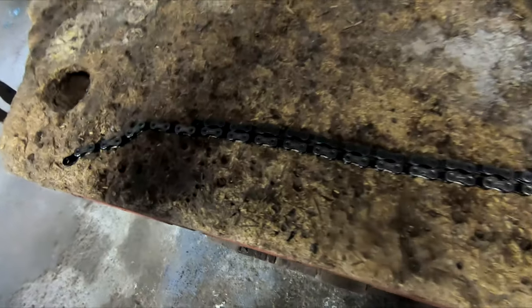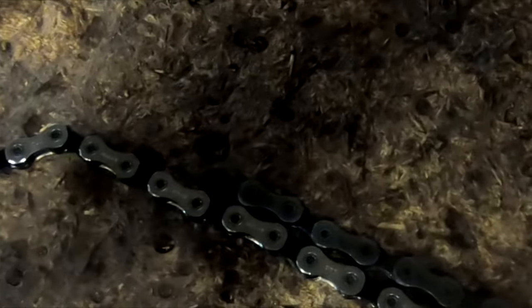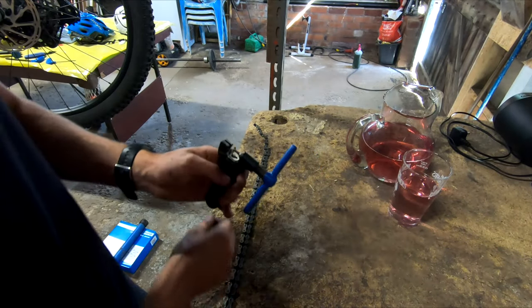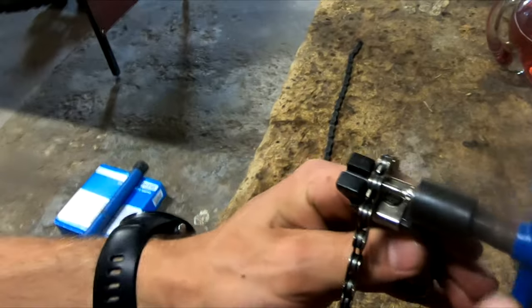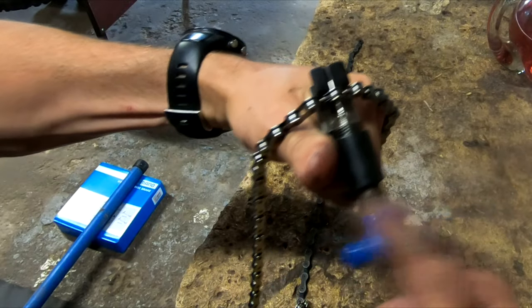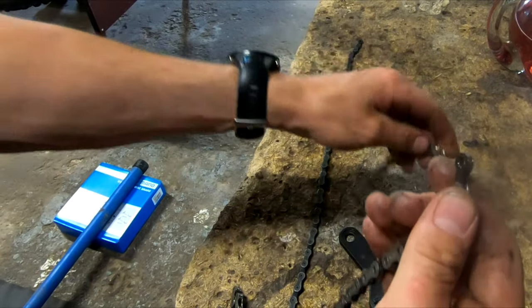Here I've got my new chain and my old chain lined up link for link. As you can see the new chain is longer than the old one, so you want to shorten it to the exact same length as your old chain so it fits on nicely. I've got my chain breaker tool here. Find the link that needs to come out, line it up in there, start winding the tool in and you'll hear a little crack - push the pin all the way through to the end so it comes out. You don't need to keep that pin. Pull it apart and there you go, ready to go on the bike.